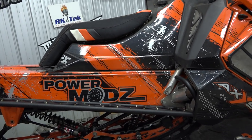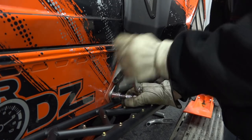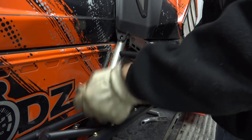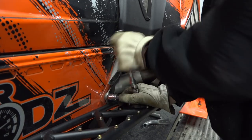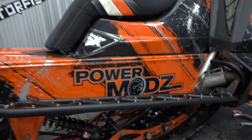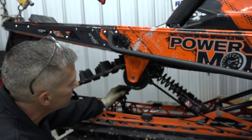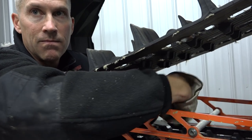When you come in and touch any of these suspension bolts, make sure you torque them up to factory spec — every sled's different. I've got to find out what the torque specs are on this and I'm going to do it, because I've had a lot of these fall out. It just ruins your day — they just fall out and you'd think you'd notice them, but nope. A pre-trip inspection is good, but when you're back in the middle of nowhere for three or four days and the sled's covered in ice and snow and it's dark — the stuff goes down. That's the way it is.